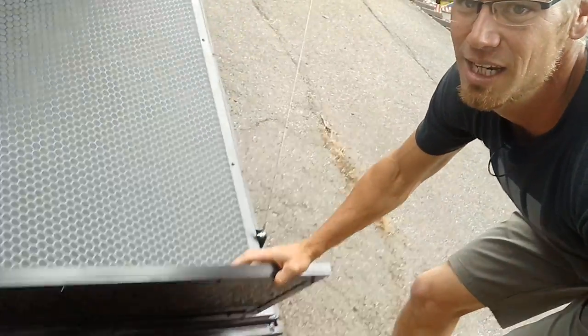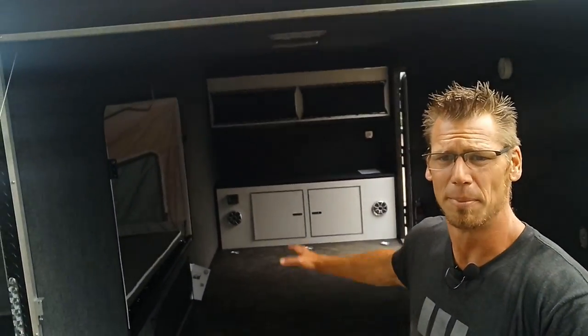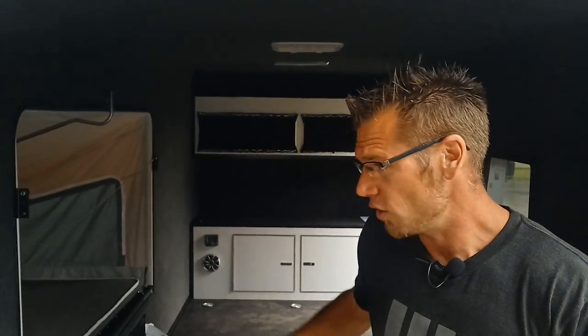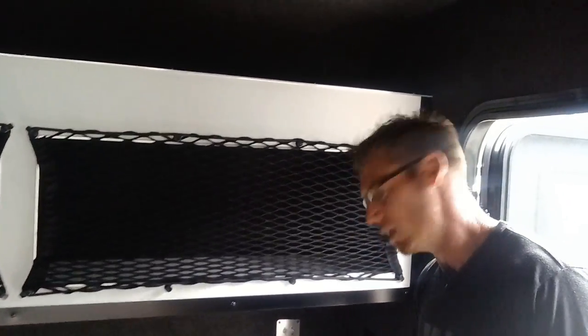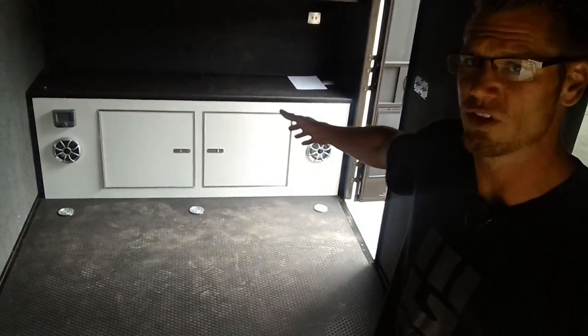We do have the flip tail to make it easier and less of an incline when we pull into it. This is a huge door — I just measured this thing: it's 72 inches wide by 78 inches tall, and that's just the actual door entrance. As far as the overall length on the interior, we're talking 72 inches wide to pull in, and then 158 inches total length of the garage. We do have six D-rings in here so we can put our UTV, side-by-side, bikes, or whatever else we want in here and secure them tightly.